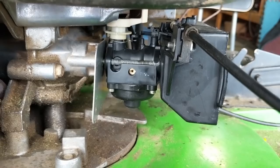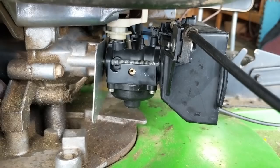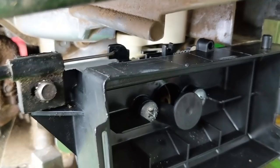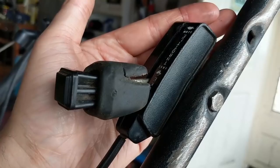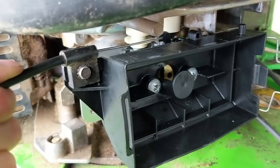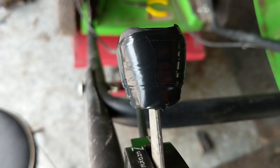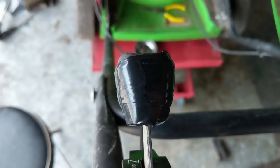Once you get your screws tightened up, put the lever on full choke. You may notice that the choke butterfly valve isn't all the way closed — that's because there is a slot on that plastic cable bracket. That little quarter inch of adjustment makes quite a difference on your lever. Once that bolt is loose, put the handle all the way forward to the choke position and push the lever until the butterfly valve closes fully. Tighten it up from there. The rubber grip on the choke throttle lever was a little cracked, so I used some electrical tape to wrap that up so it won't slip down and prevent the lever from reaching full choke.